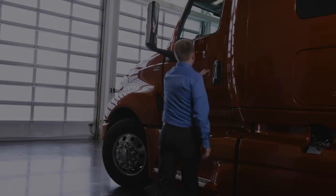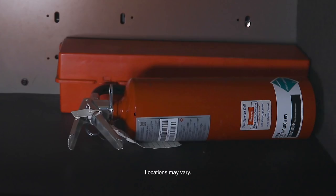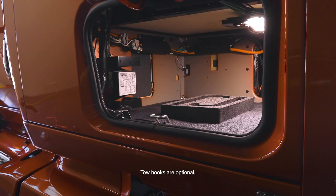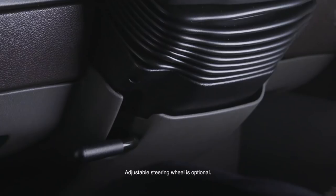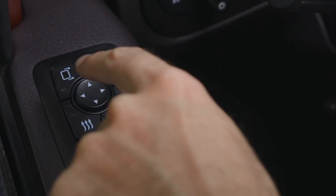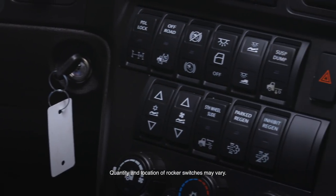Let's get inside your International truck and get ready to hit the road. Typical fire extinguisher locations are adjacent to or behind the driver's seat or under the lower sleeper bunk. Typical safety triangle locations include adjacent to or behind the driver's seat or under the lower sleeper bunk. Optional tow hooks are stowed in the luggage compartment on sleeper cabs and behind the seats on day cabs. To adjust steering wheel position, push the lever firmly downward, adjust the steering wheel angle and position, then pull the lever firmly upward to lock the position prior to operating the vehicle.